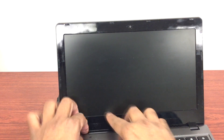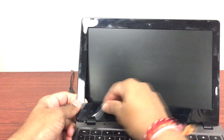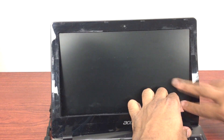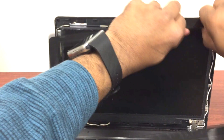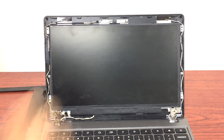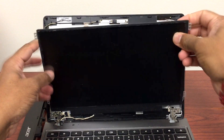So what we'll do to fix this issue is unplug the LCD and plug it back in. First we'll take off the front cover, and then we're gonna take out those four screws on each corner of the LCD. Here you can see the LCD cable — that's what we need to unplug and plug back in.